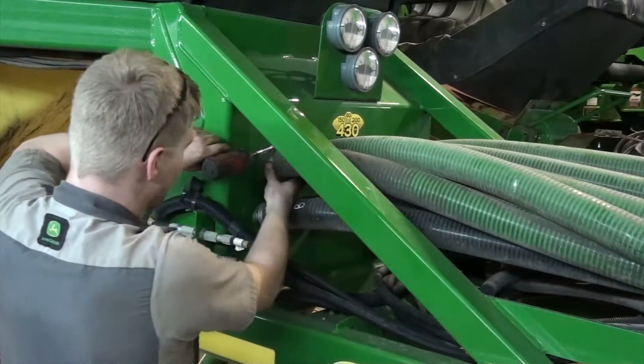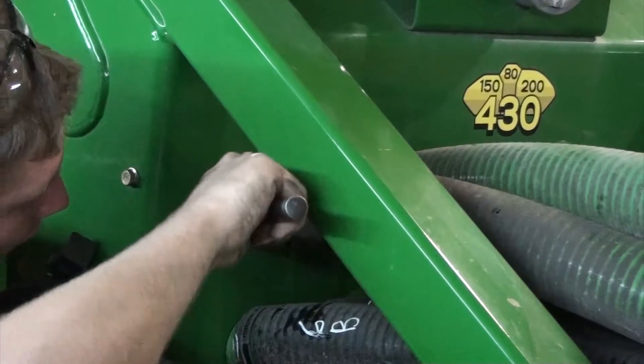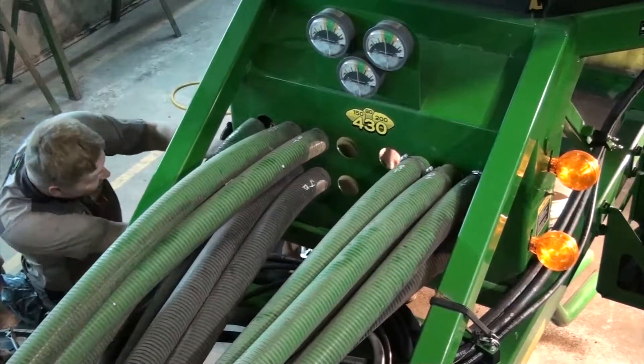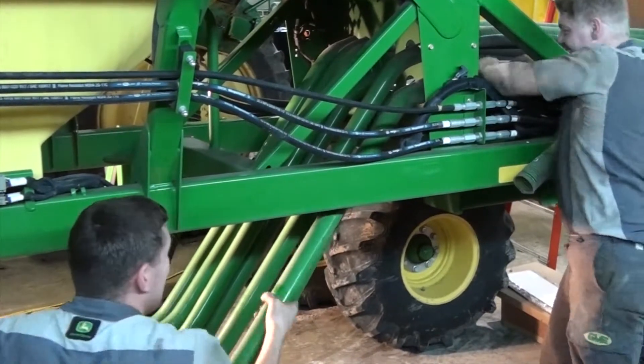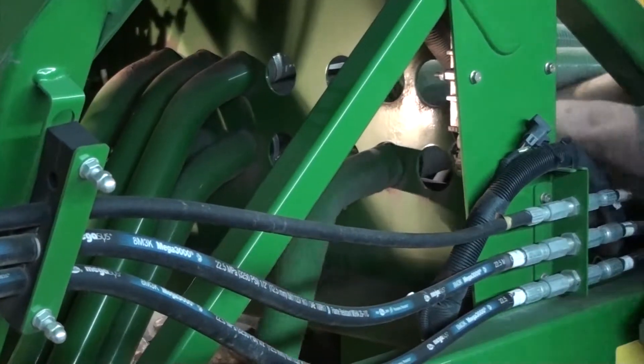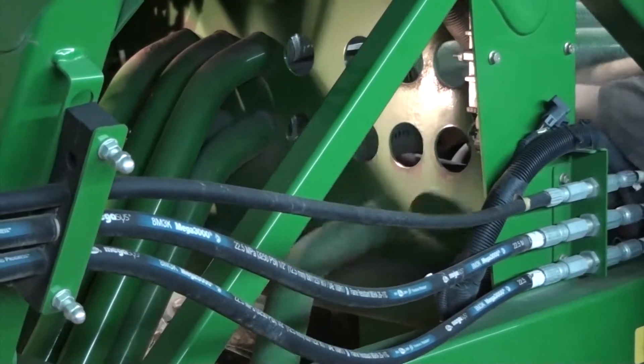As this is the front tank, to remove the tubes we'll first need to disconnect the hoses. For each hose we'll loosen the hose clamp and pry the hose off part way, and then with a lot of twisting and pulling we can get the hose disconnected.